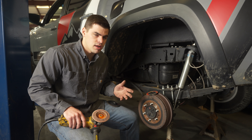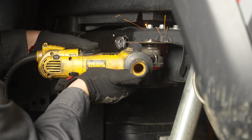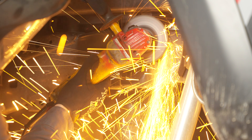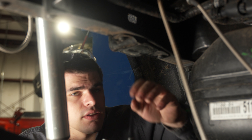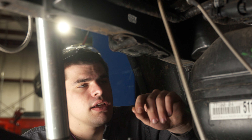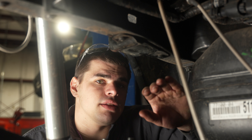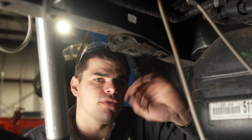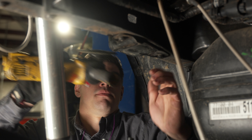For this step, make sure you wear all your PPE: face shield, hearing protection, and gloves. This is a tight area. Specifically on the driver's side, you have two rivets underneath the front side of the bracket, and one rivet is very close to the gas tank. Make sure when you get that grinder in there it's oriented correctly so you're not throwing sparks toward or possibly nicking that fuel tank. Make sure you know which way the wheel is spinning so you're throwing sparks away from the fuel tank.